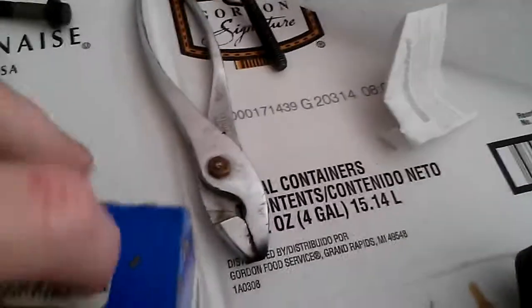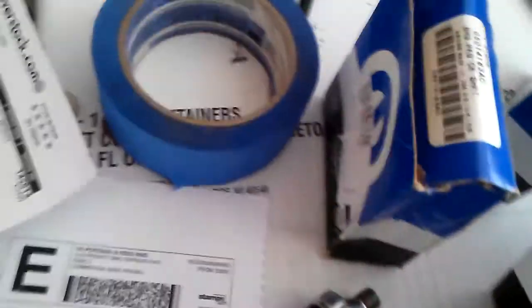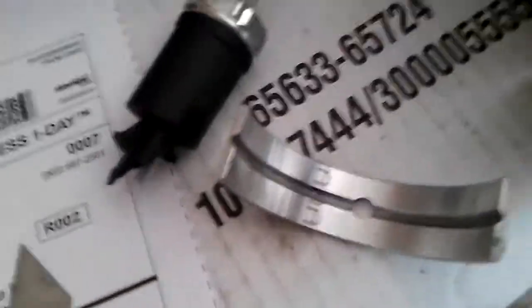This one's not that bad, but I was kind of upset because I was hoping to get my engine put together this weekend. But no, they sent me bearings that are absolutely destroyed. You can see the scoring on there. When you get any type of engine bearing, make sure you inspect them because this is really important stuff. You can see that one's pretty good, but this one is no good.